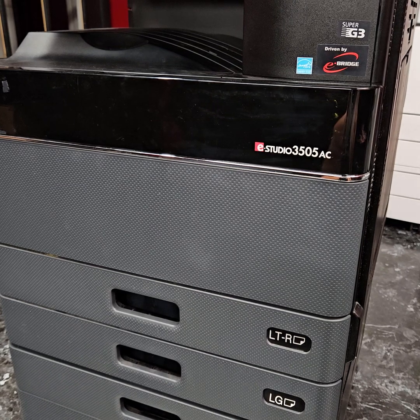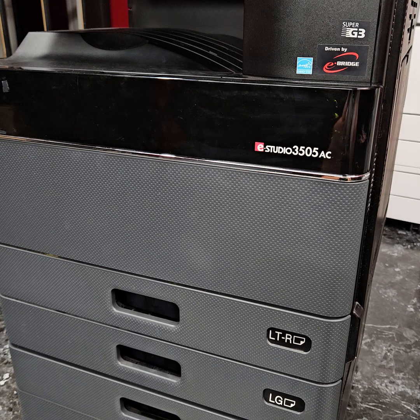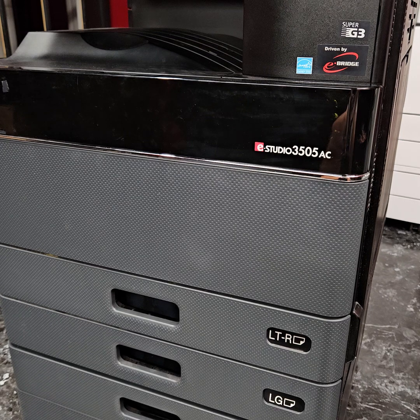It could be the cleaning unit is clogged up. It also could be just dirty sensors. All right, so the first thing we're going to do is I'm going to show you how to pull all this stuff out and what to check to see what there might be an issue with. So one thing also that can cause a CE20 is just a bad drum unit. You've got a drum unit where the developer unit has seized up and is not turning, or it's not turning properly. It will not put the color right on a patch that goes onto the transfer belt, which the transfer belt, there are sensors in there that read the patch that goes onto the transfer belt.